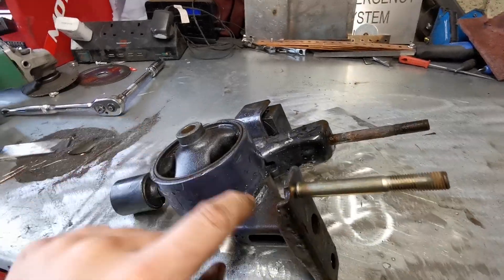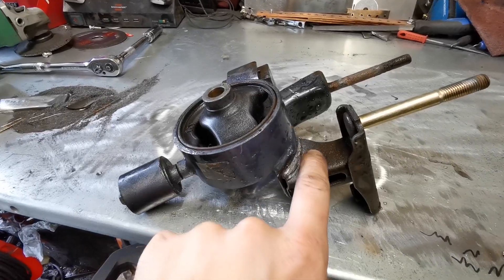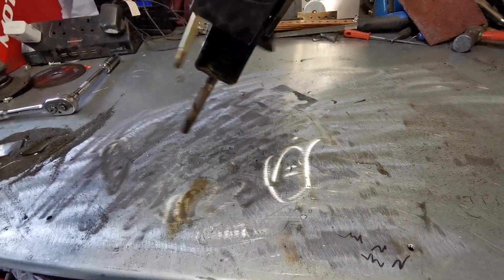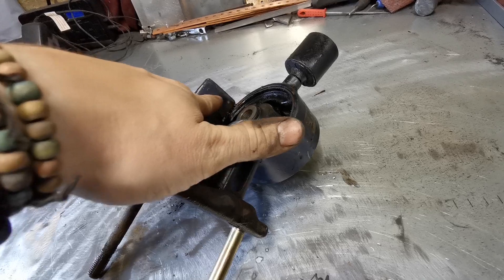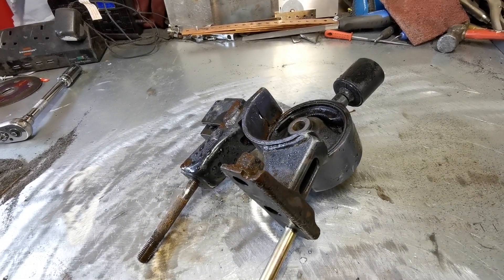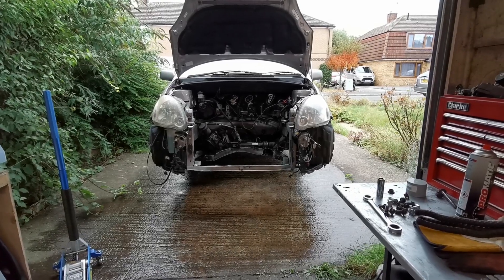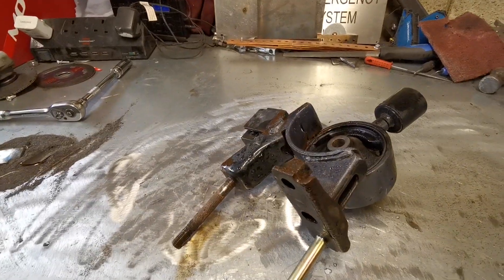Also, this was just held on with a bead of weld in a single plane, so I'm going to put a couple of little braces there and there to give some strength to it, and I'm just going to chop that across there and that across there, just to make it look a bit better and clear stuff up. Lots of little jobs - what do you reckon the odds are of us actually getting on to closing up all the holes in that this episode? Lol. Onwards.